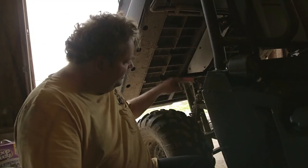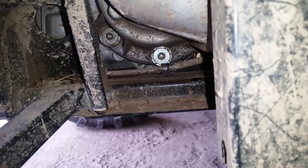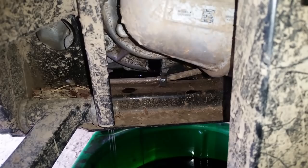The last part, this backside, is a real pain — it's very poorly designed. We're here on the passenger side, and we're looking at the main gear case, the main transmission. The plugs are right there: the top one is your fill and level checker, and the bottom one is the drain. When we drain it, it's going to run all over the skid plate. We'll drag the drain pan here first, get that drain down, and put that plug back in. The drain plug — the bottom shiny one — just needs a long extension. Easy to get to. The top fill plug, though, needs some acrobatics.